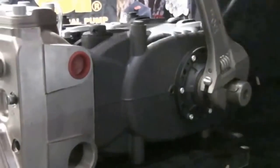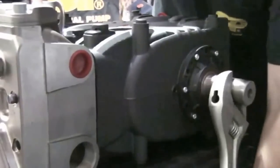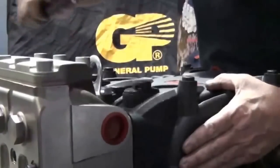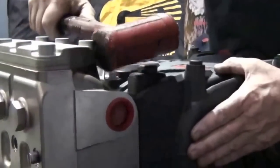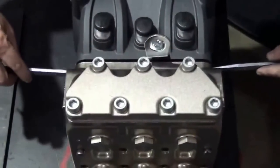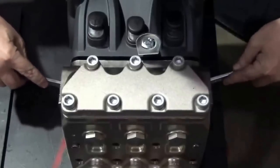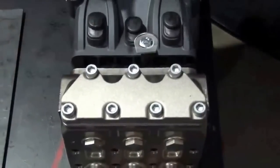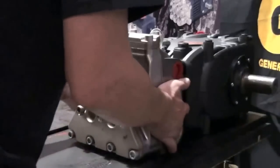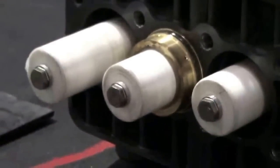Use an adjustable wrench to rotate the crankshaft. This will develop a space between the manifold and the crankcase. If necessary, use the soft rubber mallet to lightly tap the manifold to provide even further separation. Insert the two pry bars into the space and gently pry the manifold further from the crankcase. Then pull and remove the manifold off the crankcase and remove the support pins.